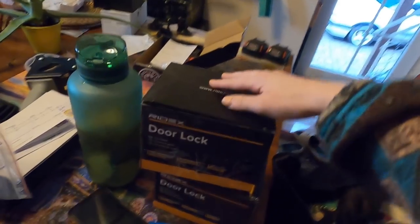I got some coolant here. I'm actually going to be switching out the door locking modules on both of the rear doors of the R32, because apparently on Mark IVs, the locks will go bad and just won't work anymore. Sometimes the doors will lock and then I can't open them at all, or they stay unlocked and they don't lock at all. It's just the two rear doors. About a year ago this happened to the passenger side door — it would just stay locked and you could never get into it. So I had to pry open the door, switch the locking module out, and it worked. And then it went bad again.